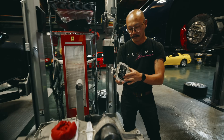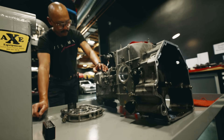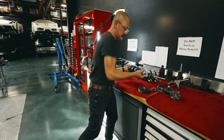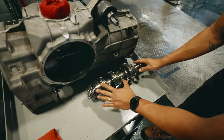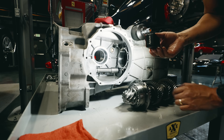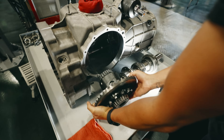To explain this a little better, this goes over here to the side of the gearbox, attaches a bunch of cables to the front, and the shift lever. Those gears that you saw — primary shaft, secondary shaft — go through this way. Let me bring the output shaft over so you can get a better idea of how the diff works. This output shaft comes out through here, and the diff goes in here.